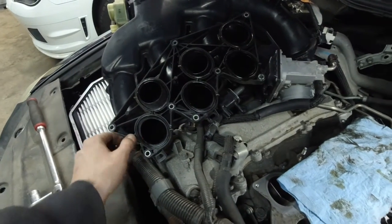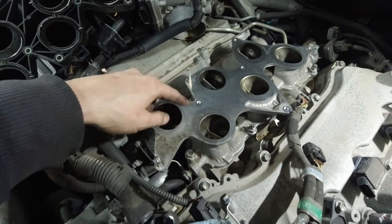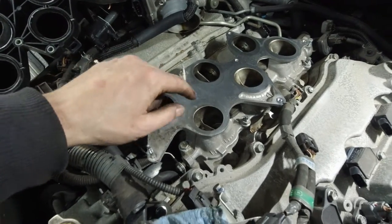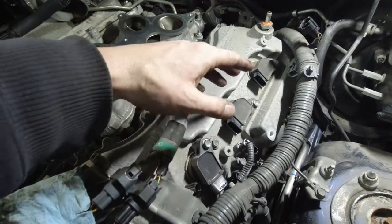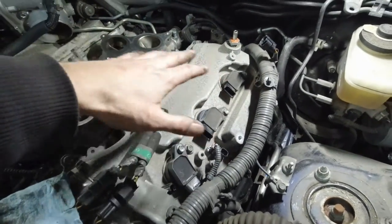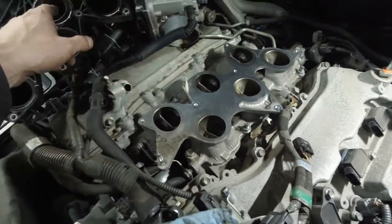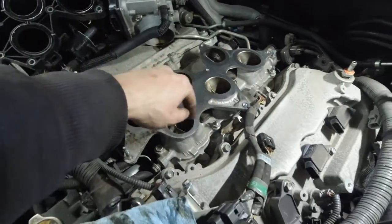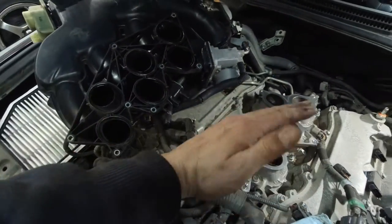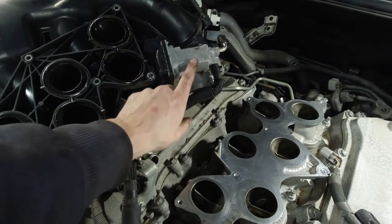Replace these gaskets here and clean this up a little bit. Make sure you don't get any dirt inside here before you take the coils off - before you take anything off. If you've got compressed air, just blow all this dirt off so when you take these off you don't get dirt inside the spark plug wells. This area will still get dirty once you take the cover off, because you won't be able to get compressed air underneath. Just carefully take this off and put it aside.